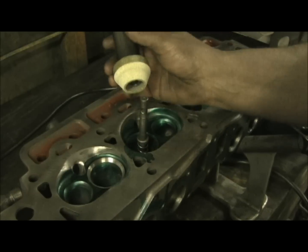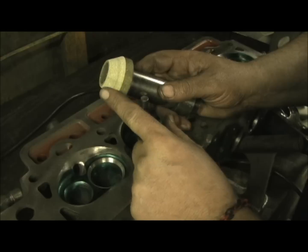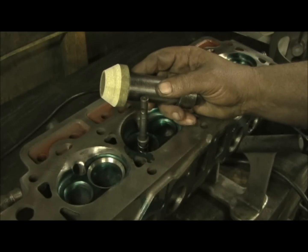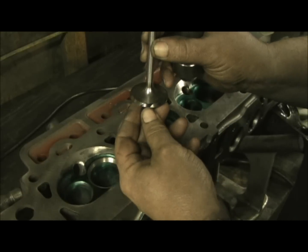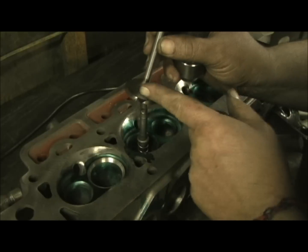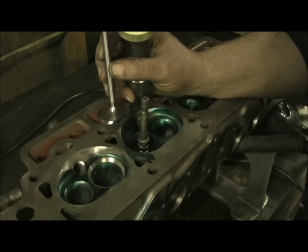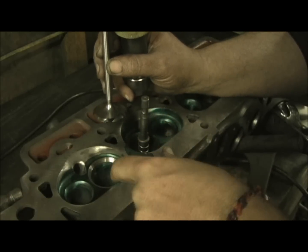I just spaced it off. This is the 60-degree stone — we say that because there's 60 degrees right here. And this is your digger, really. Most of the factory valve jobs are always on the high part of the valve. I showed you how I always mark the valve black — it's all the way up in here and gigantic wide. We're going to turn this into a killer airflow performance deal by thinning the seat, moving it to the edge, and digging some in this bowl.